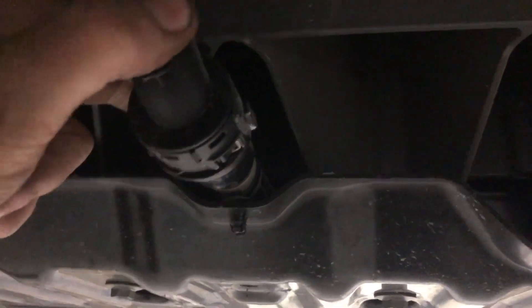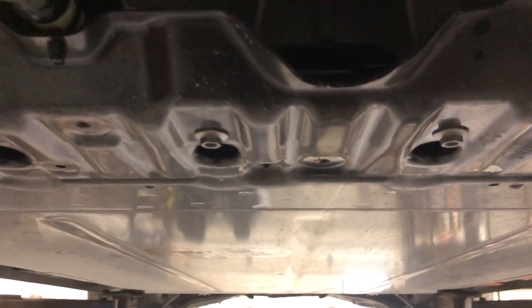Here you can see the giga structure again where this is bolted up to. This is high voltage coming from the back side up to the front motor. Coolant tube in for the battery — this looks like a bit of a different scheme. The old pack had coolant tube coming into a header manifold that would split through the four cells on the Model 3 pack. This one looks like it comes in here, runs to this side of the battery pack, to this fitting here, into the battery, through the battery, and back out the other side.